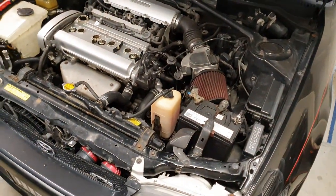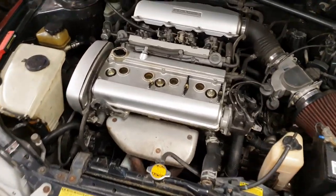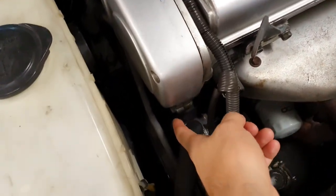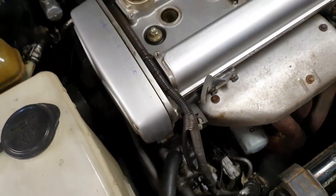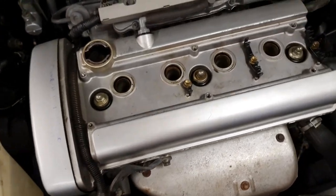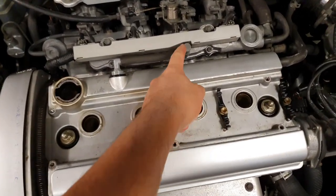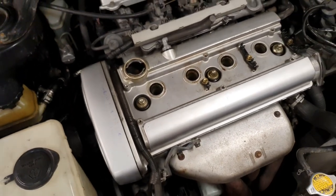The car's in the shed now. I've just pulled off the top cover and I'm about to pull off the cam gear cover. I'm just trying to get to this bottom one at the moment, and then once it's off I can undo all these three here - the whole lot should just pull off and pull out this pipe here. It's pretty quick and simple.